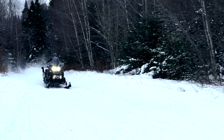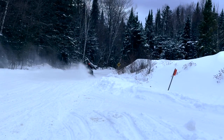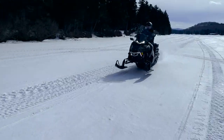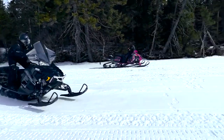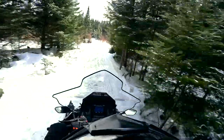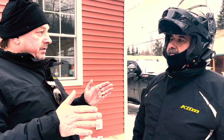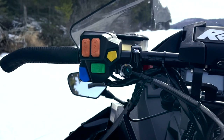Sound of the engine and that kind of stuff — very quiet, easy going. The only time you can really hear the motor is when you smash the throttle. I think it's the intake I'm hearing. Because of the old Axis chassis, the air intakes are kind of pointed back at you, so I'm hearing that drone. Just cruising around at trail speeds up to 30, 40 miles an hour, it's nice and quiet. If they put that in the Matrix chassis with the air intakes out to the side, it'll quiet down that drone. That would definitely help.